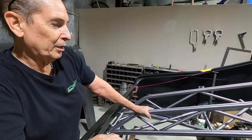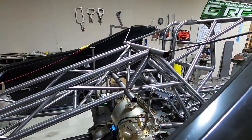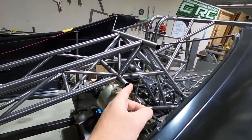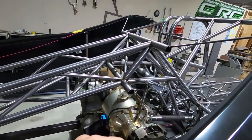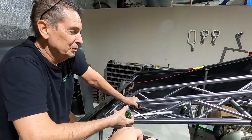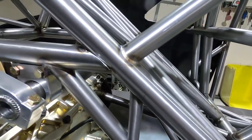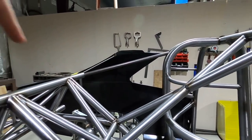The back needs to be strong for the parachute, but from here forward there's so much stress you can't imagine — that's why you see so many tubes. Everyone gets serious about heavy-duty anti-roll bars, but if you put a heavy-duty anti-roll bar in and your chassis twists, the anti-roll bar can't do its job. Zero flex — the anti-roll bar is what does the flex. There are a lot of gussets leading up to where the anti-roll bar is mounted, and there'll be another X up top.